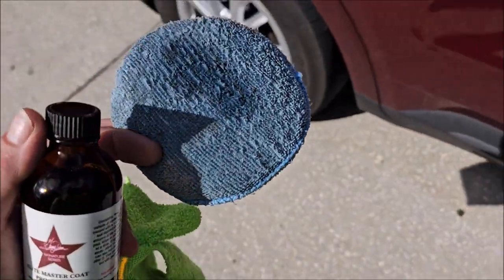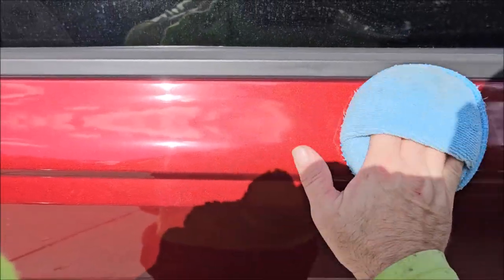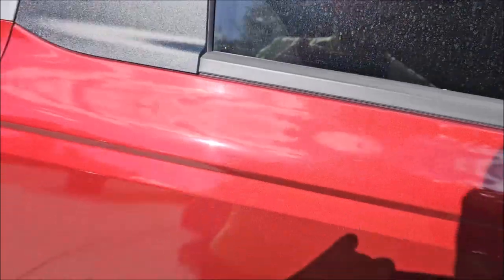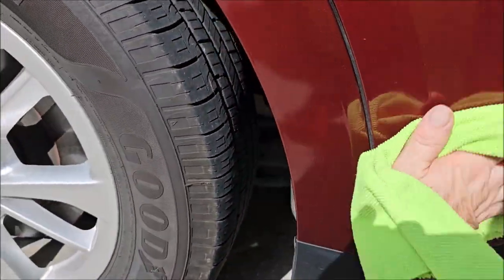Just as a test, I have applied a little bit of the Fast 5 Ceramic to this applicator, and I am going to go ahead and apply it to this side that I just did, so that you can see how amazing this stuff is and how it all works together. You can see it's applied — and you don't have to wait, you just buff it right off. You do need to wait 30 minutes from the time that you've polished a section to the time that you go back over it with this stuff, because the polish has to cure — the ceramic acrylics blend in there has to cure.